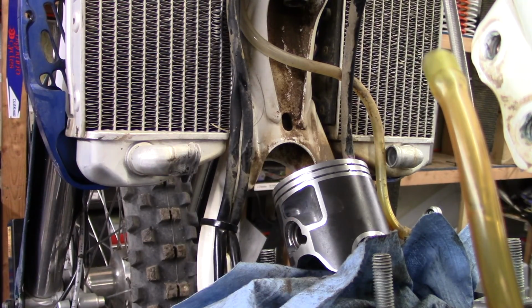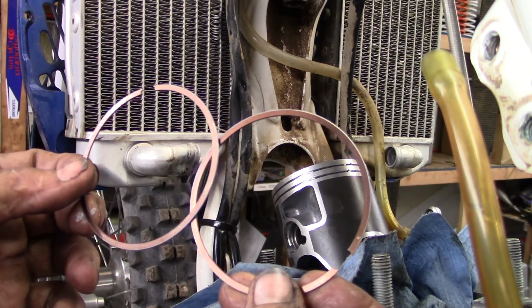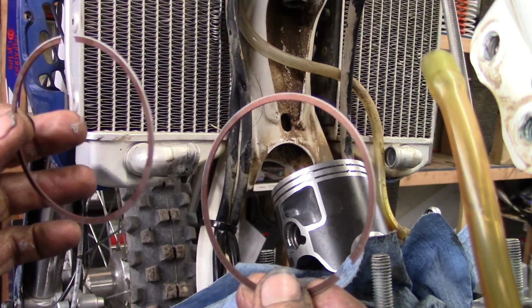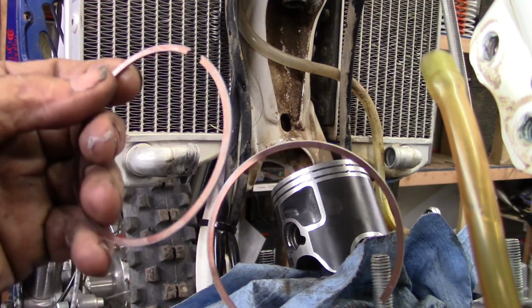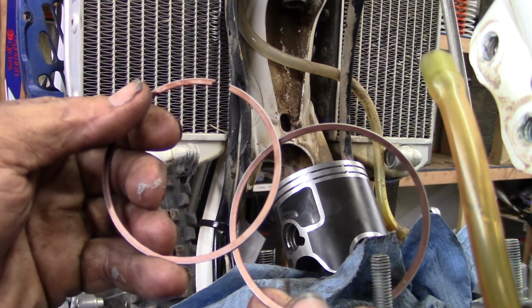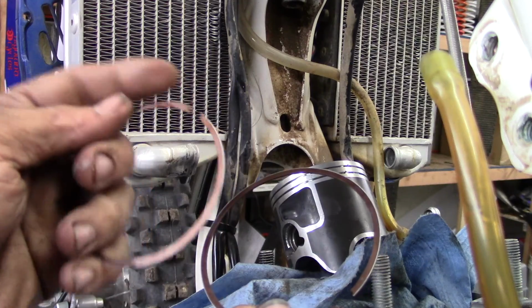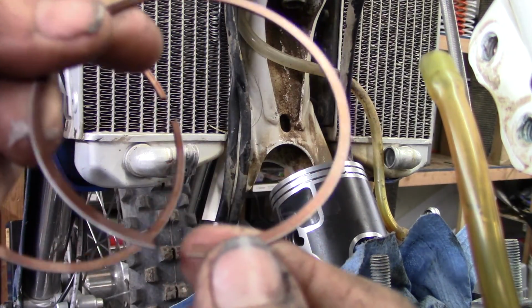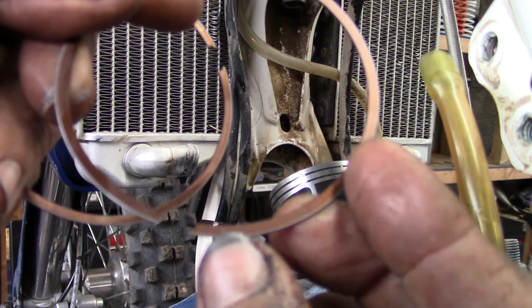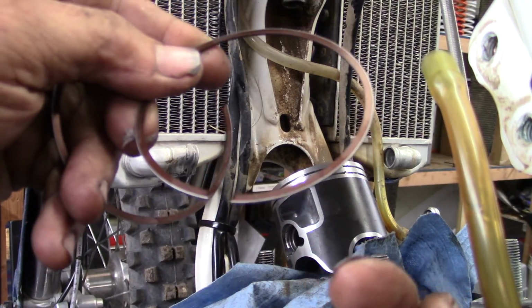I've already checked the ring end gap on these. I will actually make a short video on how to check ring end gap. It's not up there yet, so maybe by the time you see this it will be, but take a look for ring end gap installation or ring end gap check on our channel, and we'll definitely get that up there. But here's one little tip as you're putting these together. See that little mark right there? On Vertex it's an N. Any kind of mark, that always goes up, right?